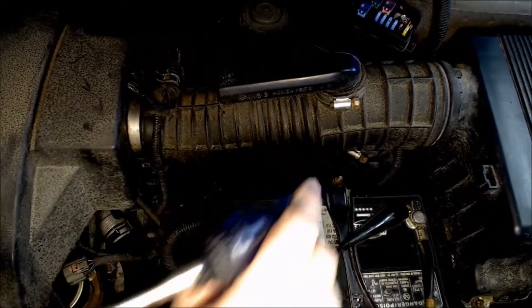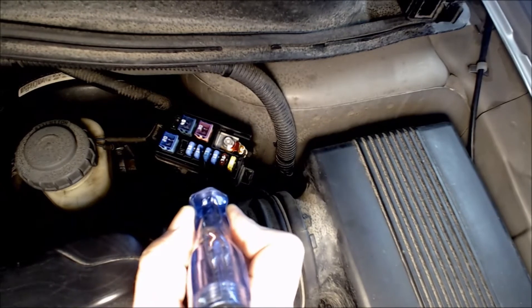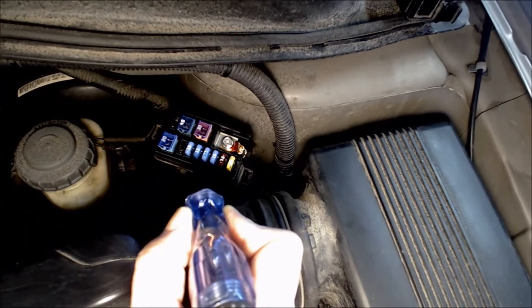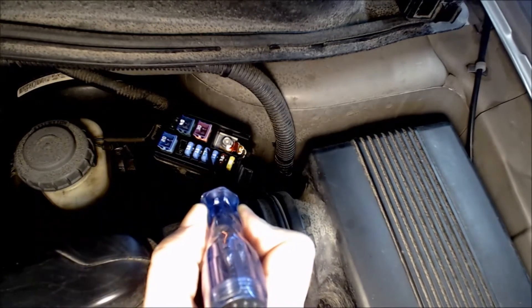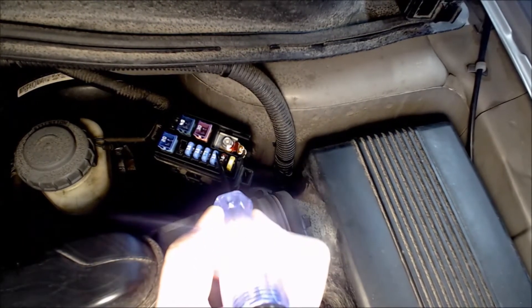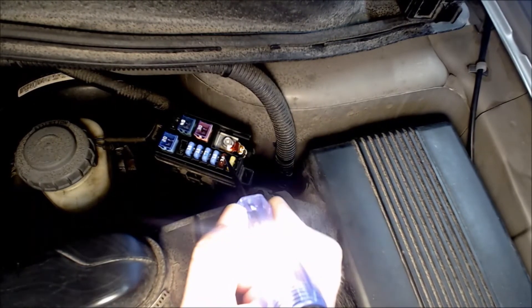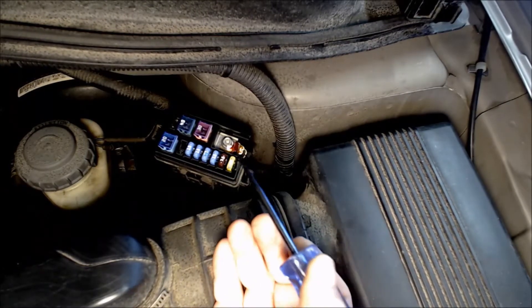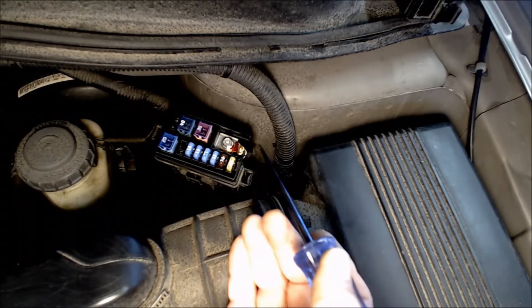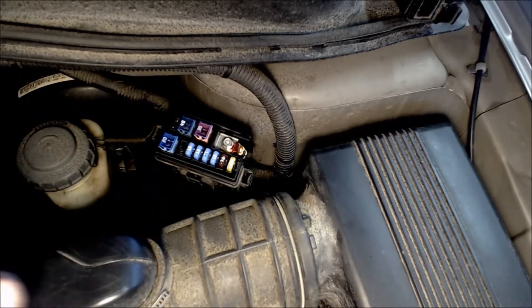I can come in here on top of these little tiny fuses. They have little tabs on them, and I can go one side and the other. If I hit a fuse where one side lights and the other side doesn't, that means I probably got a blown fuse. If I hit a fuse that doesn't have any power on either side, that generally means that the whole fuse circuit is off — it probably goes on with the key, but it might not.